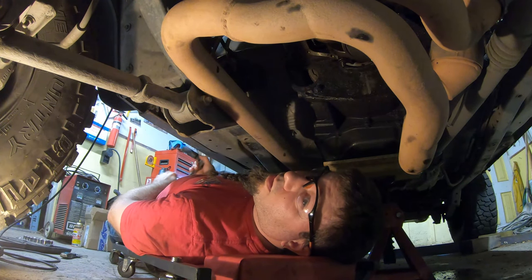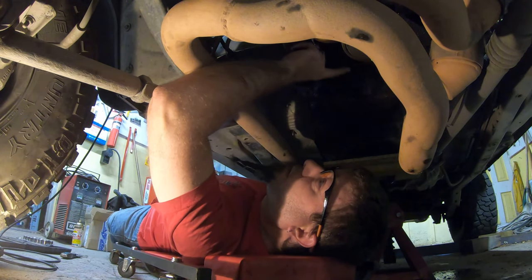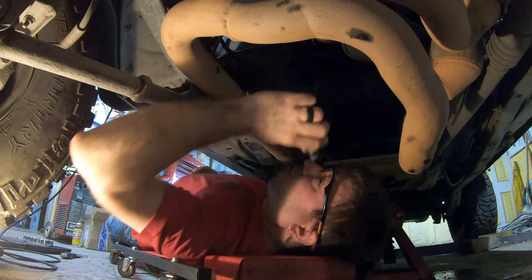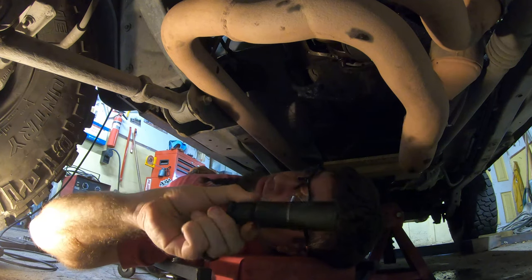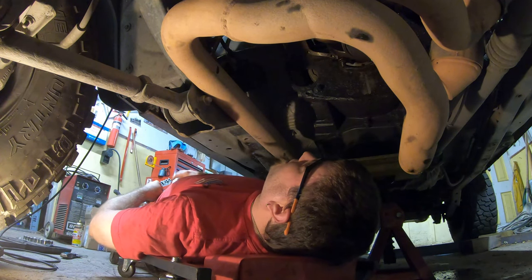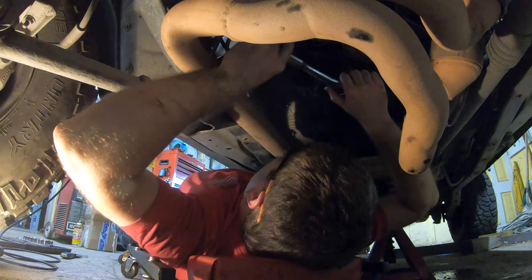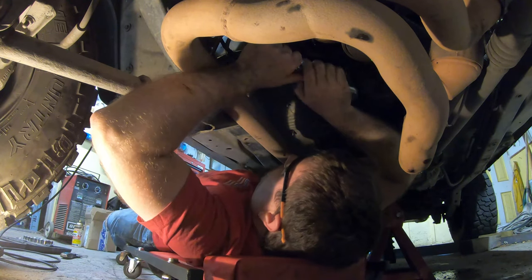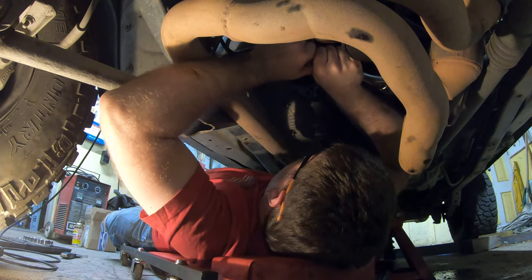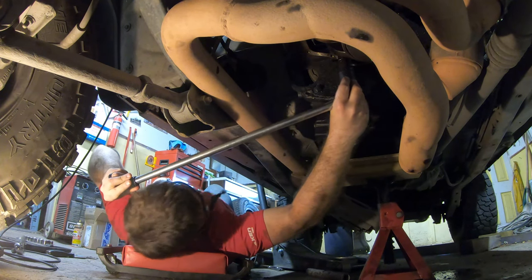So with any luck you guys can see me - it took a bit of digging, but 13/16ths is what you need to get these retaining bolts out. The rearmost one right here you have to take out. These are specialized bolts - I'll show them to you once I get them out. It turns out my Motivex tools that I just bought is the only 13/16ths I have in my whole shop. I thought it was 20 millimeter and went to a friend's to pick one up, and it turned out not to fit. So I did some googling and sure enough - 13/16ths. They're like 80 foot-pounds, so I may need a breaker bar.